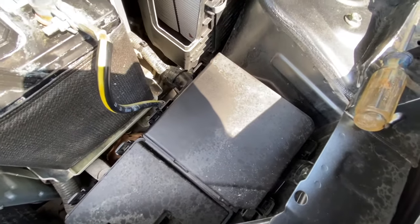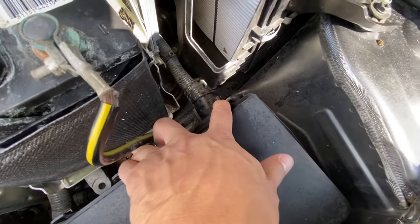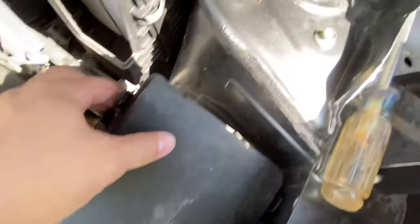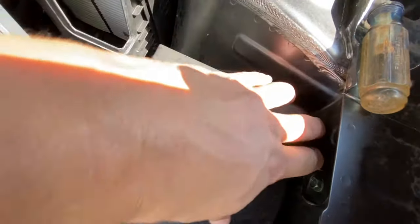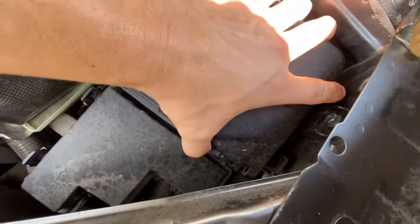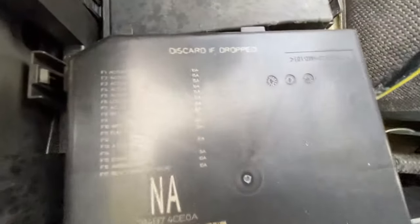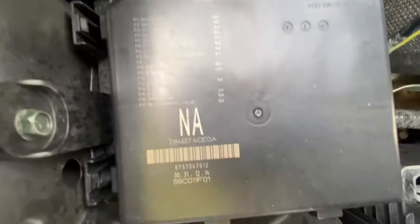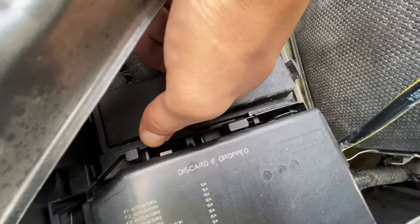Second fuse box location is right in here. You just take the pins right here, press on this one and that one, and that should go up. There are actually two more in the back — one here and one here — so total of four. Once you've got that, here you have the location of the fuses and which ones are which. If you want to pull this one up, you go this way and that one this way.